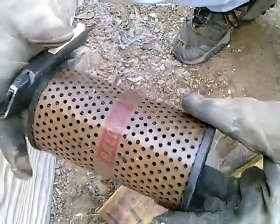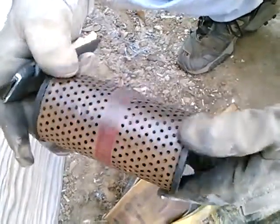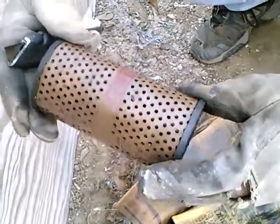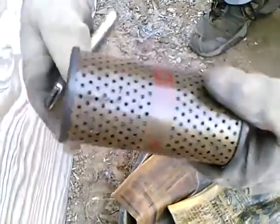This particular engine has got a lot of gasoline mixed with the oil. I'm not sure why. So the oil is very thin and I think it's scouring a lot of grit out of the engine. There was a lot of grit in the canister that surrounds this.